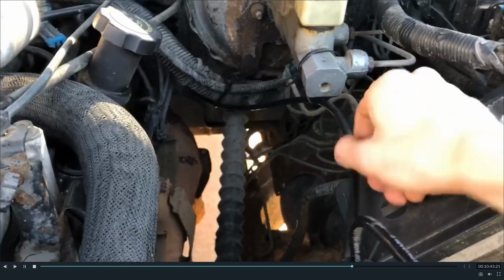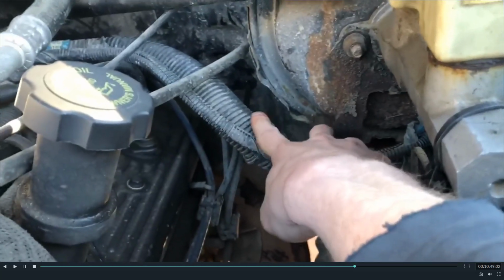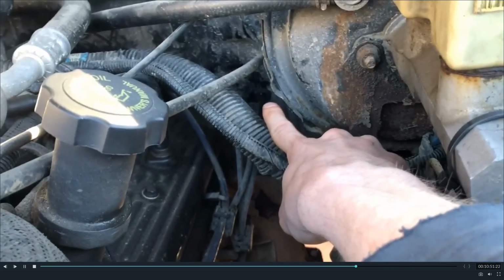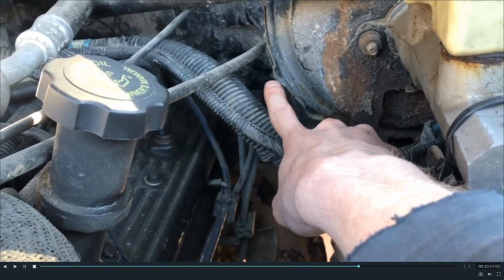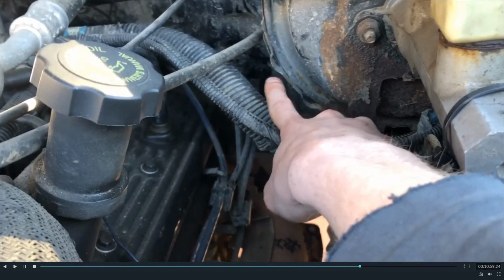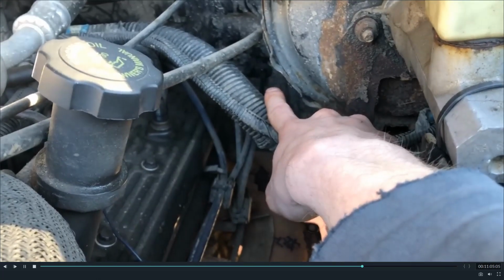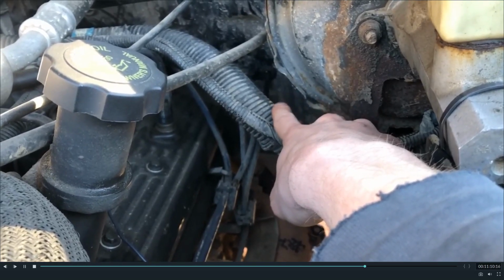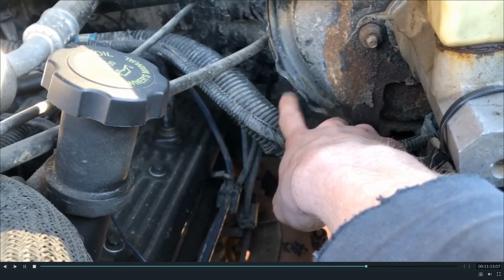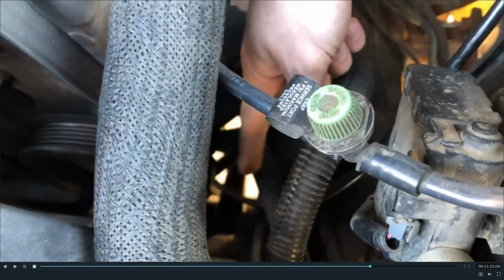All right, right here we can see the cable for the front axle linkage. It's kind of difficult to see, but right about there, there's a little rubber grommet that comes in the kit as well, the Posi-Lock kit. You will have to drill a hole in your firewall. It gives you the size of what you should drill that out to. You can find a spot. Where we drilled it was right up by the gas pedal, right above the pivot mount for it. This snakes its way around here, down to the front axle. You can see it right there.